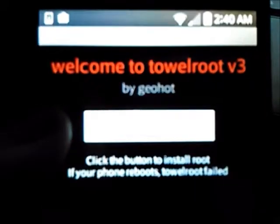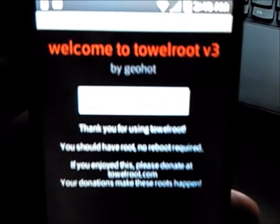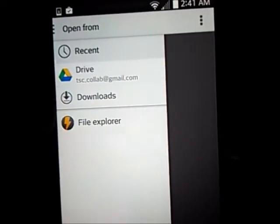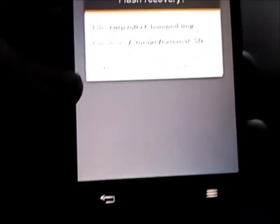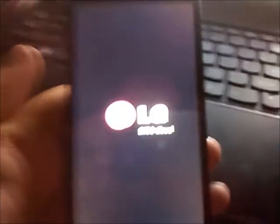Once it's back in the phone, download TowelRoot, install it, and download Flashify. Open up TowelRoot and click 'make it rain.' Also make sure you download the SuperSU binaries from Chainfire and the TWRP recovery image and place those on your external SD card. Once you are rooted, you're going to use Flashify to flash the TWRP recovery — choose the location on the external SD card, find it, and flash recovery. Then reboot into recovery.